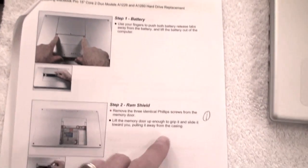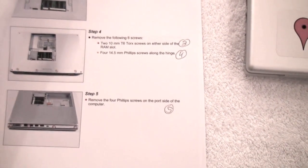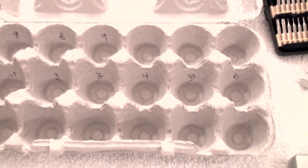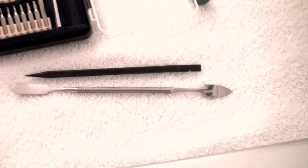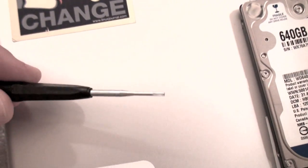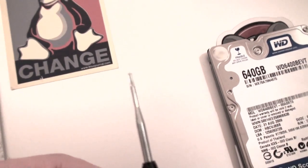Get one of these when you're doing your cloning. So quickly, about the iFixit guide — I've gone through and numbered a bunch of places where I remove the screws. I have this high-tech screw holder here; it's just an old egg carton that I've labeled, so I just drop the screws in as I go. Some of the other tools I have are spudgers and some different screwdriver heads. This is a Torx 6 screwdriver, and you need to have one of these if you're going to be taking apart a Mac.